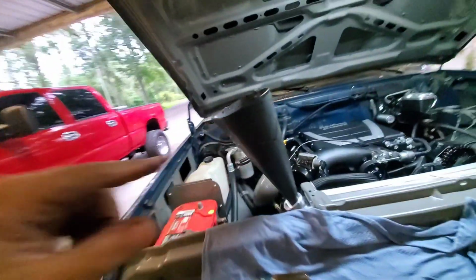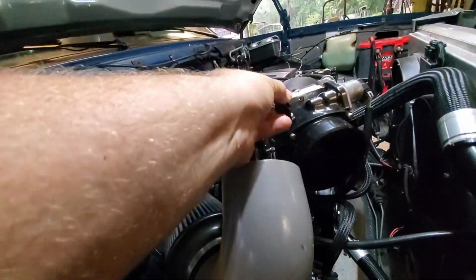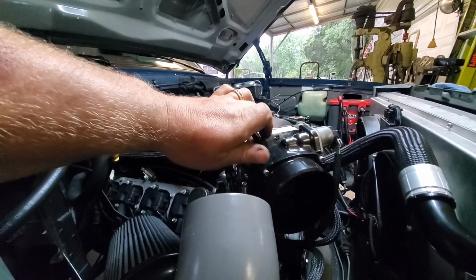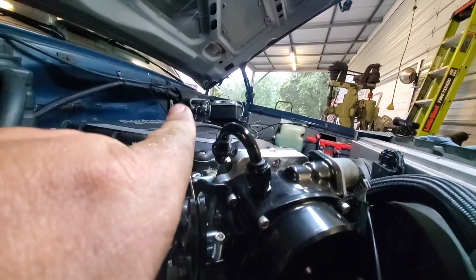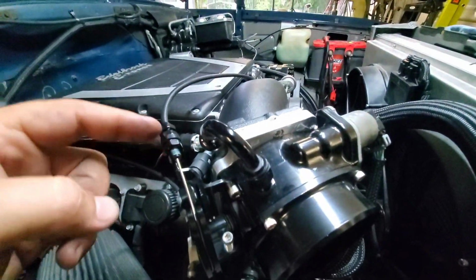So just been slowly topping that off, but I forgot another thing that we have to do that we talked about earlier. On the throttle body, we have the number 6 AN hose on the top here. So I grabbed a fitting and went with 150 degree, because I like putting all that extra bend on stuff when it needs it. A 90 would be a standard fitting and it would have it kind of pointing up in the sky. Well, now it tucks it down, behind the throttle body area,